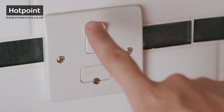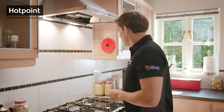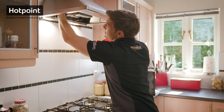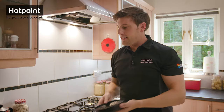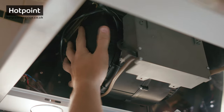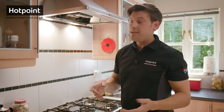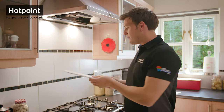Safety first — make sure you switch off your cooker hood before you start doing any work. Begin by taking off the grease filter, then reach inside, take hold of the charcoal filter, and turn anti-clockwise and it will come out nice and easily. Then take your new one, line it back up, turn it clockwise, it clicks and it's in. Do the same for the other side and then replace the grease filters.